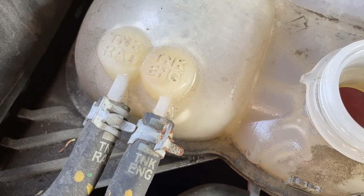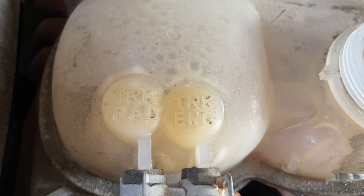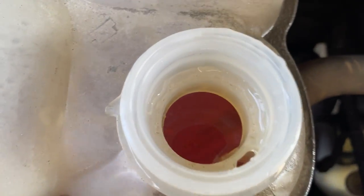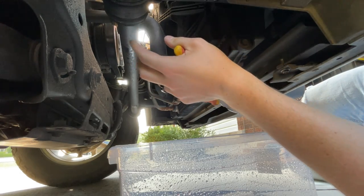We've got a small return from the engine — the upper rad hose is already hot and we've got very hot air coming out. I'm going to drop the coolant from the bottom and see if any more dirt comes out. I started taking the water out but it was still barely warm, so obviously didn't run it enough. Starting again — we can now see some return from the tank, and coolant is just starting to come back from the rad. Once we get proper flow through there and get it up to temperature, we'll pull it apart.